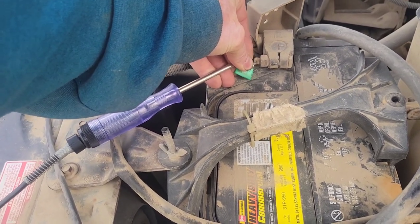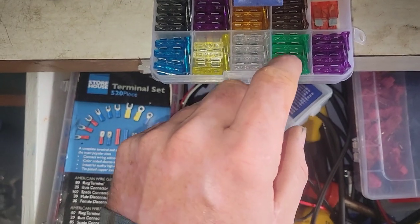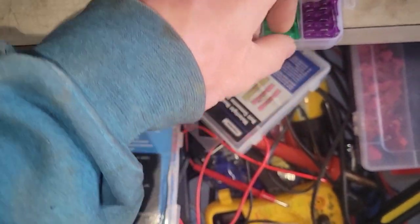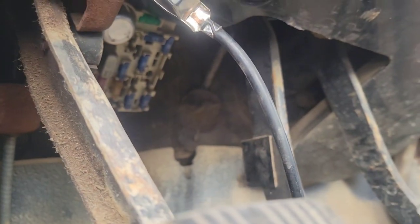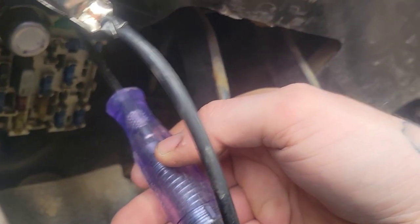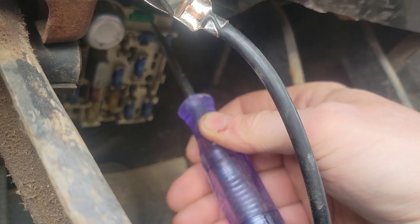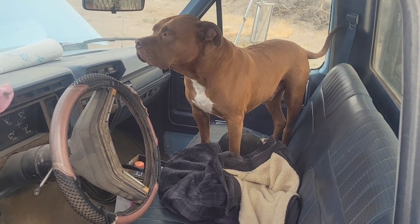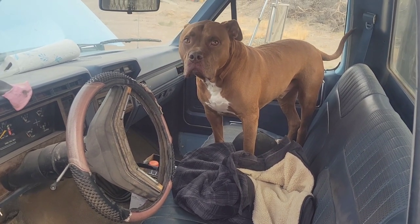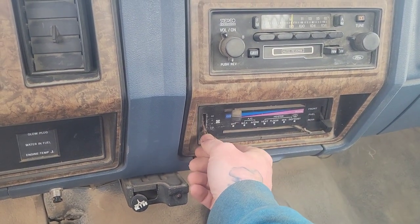So my heater issue might be just as simple as needing a fuse. I come back into my electrical drawer and I've got this set of fuses - looks like the green is a 30 amp, so let's go ahead and grab one of those. Another way to test a fuse without pulling it: with the key on, see if you've got power on one side with the test light and check the other side - that says it's sending power through that fuse, so it's not a blown fuse. I put the new fuse in, got it on defrost, and we're still getting nothing.